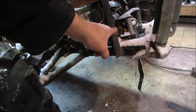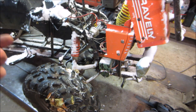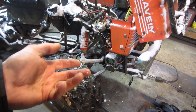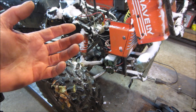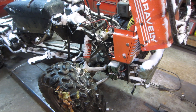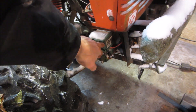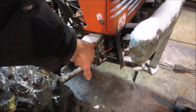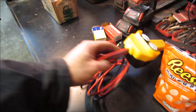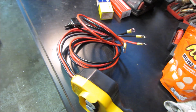My issue, I do believe, is the winch. Didn't even realize it had a winch — yeah, there's a winch tucked underneath the front. It's a Harbor Freight winch. They got real popular five or six years ago with the stupid remote control for them. The old school ones just had a big heavy cable going to a controller and back to the winch motor, and those did not have that issue. My assumption is that the new ones are always looking for a signal from the remote, so something electronically stays on all the time and slowly runs the battery down. We have one of the good old-school style winch controls with heavy cables — two go right to the battery.